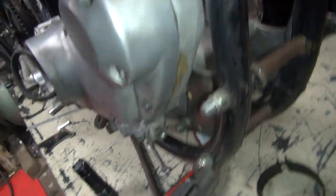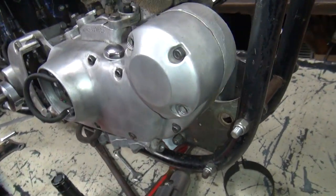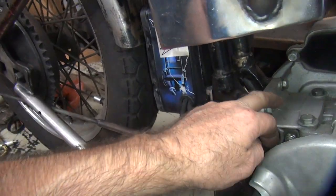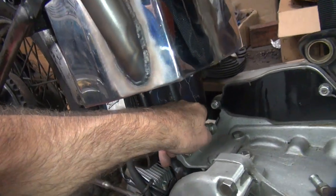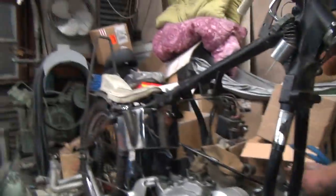After you do this top one here, then I usually get this bottom one over here, and that holds the plates, and then you tighten the other two up, be fine. When you put these in, you gotta make sure you have the spacer in here between the frame and this one. Otherwise the frame will have to squeeze together, which would be bad. Okay, now we go ahead and tighten these up the rest of the way. So you need to get back there with the wrench in the back, where you can torque it. You gotta tighten these things up.